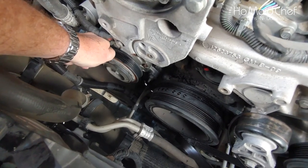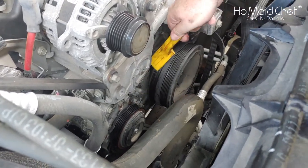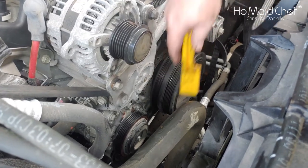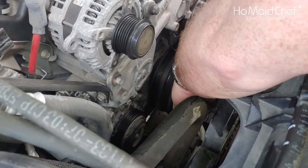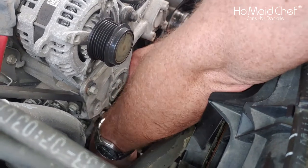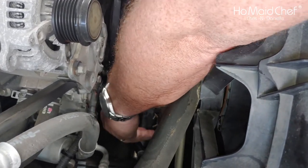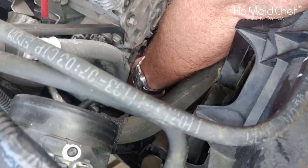We cleaned off the pulley with a wire brush and rotated the crank. When you're rotating the crank, go slow because you want to bleed off the compression — you don't want to fight trying to turn over and compress the air in the cylinders. We're going to put the belt all the way over our big crank pulley and come down to our little pulley, so we're not trying to pull it over all of this.